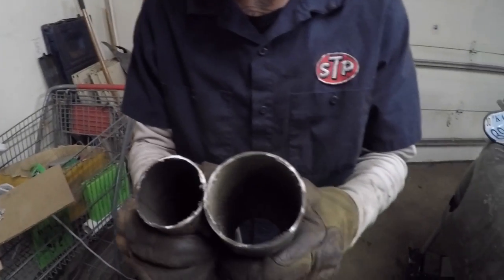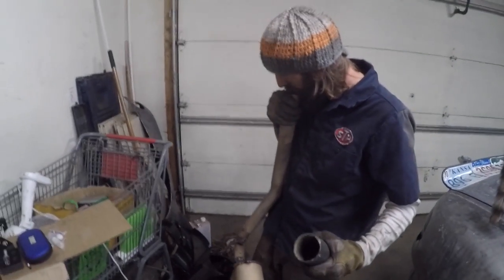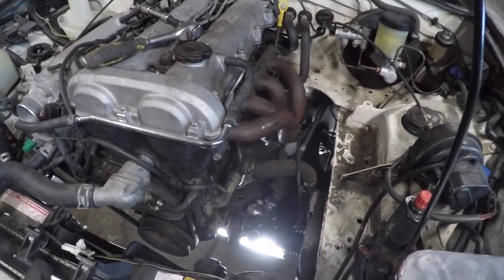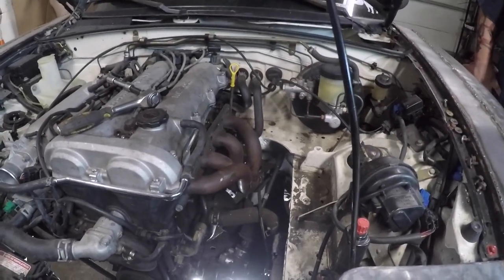This is what was in the car, and this is what we're putting in the car — a lot better. We got this stubborn thing back in and got the bung mounted for the O2 sensor. Be gentle with those; they're expensive to replace and a pain in the ass if you have to swap one unnecessarily. That's it for today. Tomorrow we'll put a flange on the straight pipe, run it to the back, and get the kink over the rear diff section. Part one of two of the two and a half inch exhaust on a Miata is complete — we'll knock out part two tomorrow afternoon. As always, like if you like it, subscribe if you want, and keep modding.